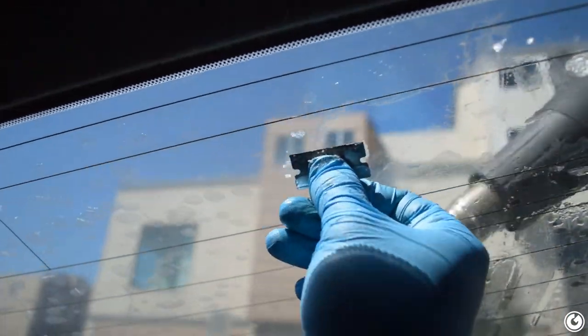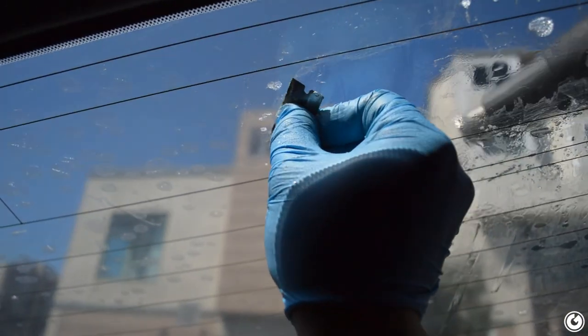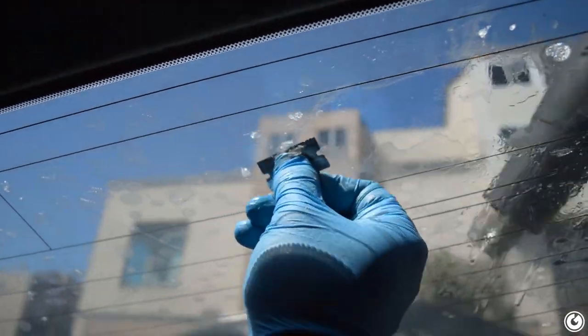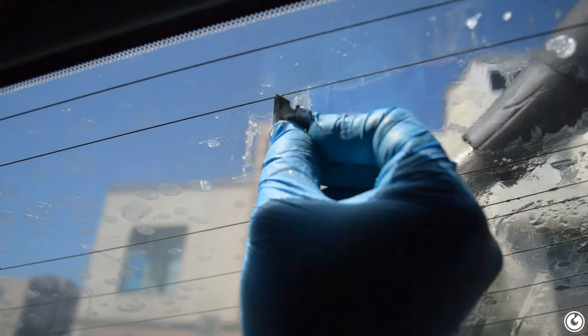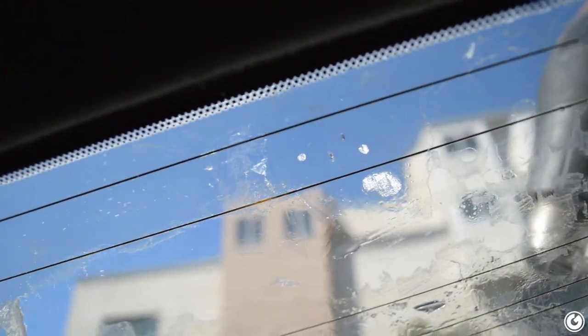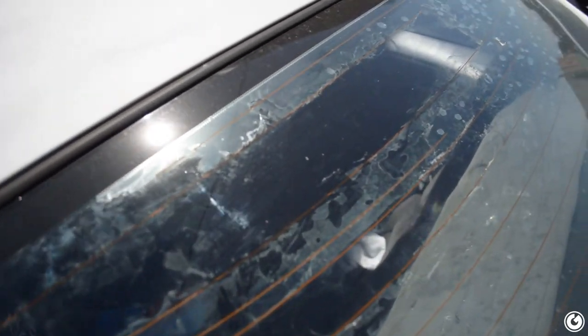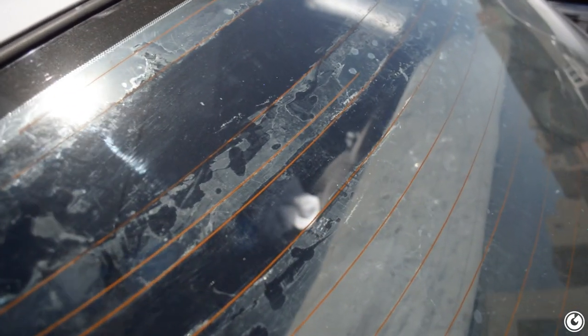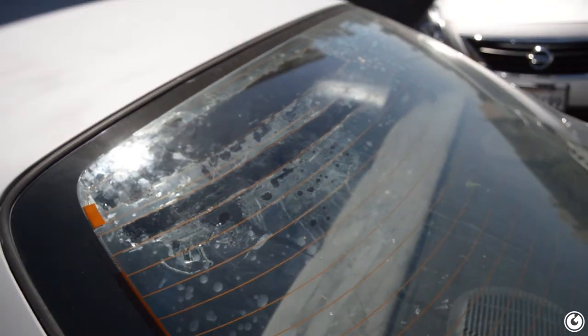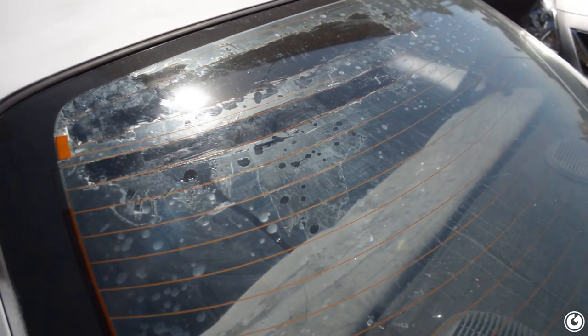Spraying ammonia and having Raylene do the heat gun — that combo was able to get me a couple of big pieces, but it was only the first layer of the vinyl so we didn't get clear windshield yet. The combo of heat on the other side and spraying Goo Gone while razoring gives me some space to chip away instead of doing this double-layer BS. Going one of these little defroster bars at a time — half a bar at a time fits the razor nicely so it's easy to scrape.